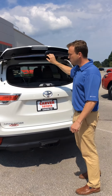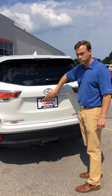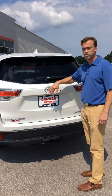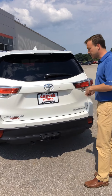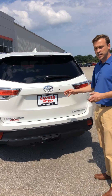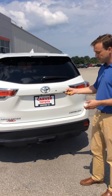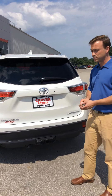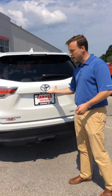But make sure you get it closed, because if you do not, the rear hatch will not actually work with the power feature. Sometimes we accidentally hit it and don't notice it, or maybe a kid comes by while we're loading in and out. When you try to operate the rear hatch, it will beep and not move — it'll come unlocked but not operate.